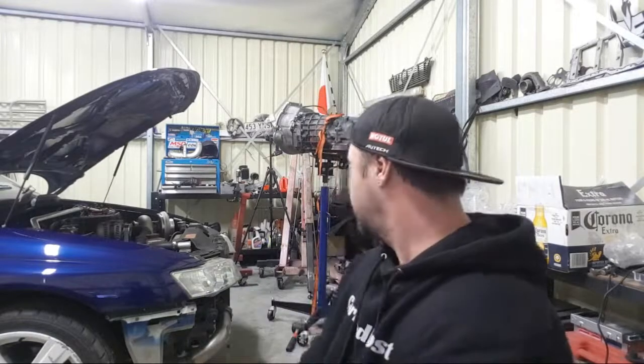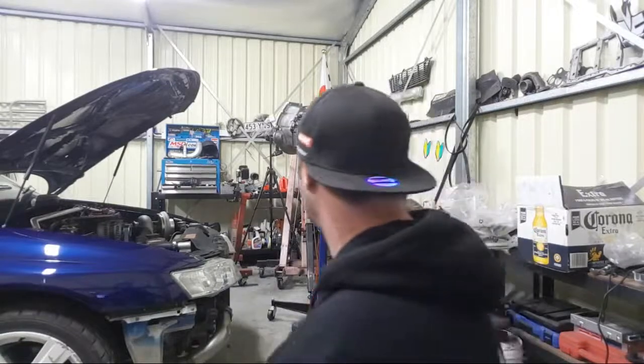Hey Scott, things are good. Front bar is off because I've been doing preparations for some new bits and pieces. The front bar is actually right there, I can see it. Cooler piping's up in the top of my toolbox there, if you can see it. Turns out my turbo did eat my boost controller wiring. I found a lot of remnants of it in the charge piping. I don't know when or how, but yeah, that sucks.